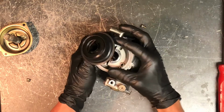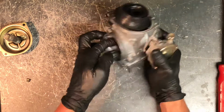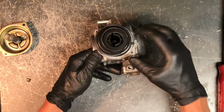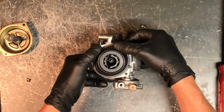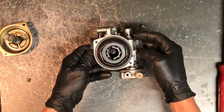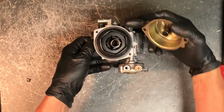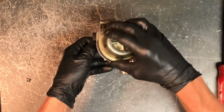and then you put your finger underneath here so it doesn't drop all the way down. Make sure your needle is falling directly into your main jet holder. Sometimes you have to guide that down. And then let it go down until it's seated properly. Take the spring, and then keep your finger underneath there, otherwise it'll go all the way down. It will kick your diaphragm out of this place it needs to be.